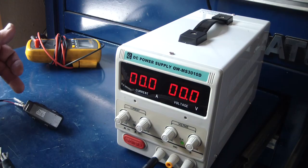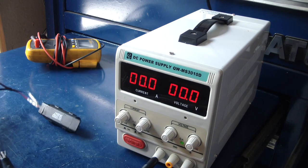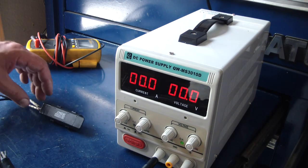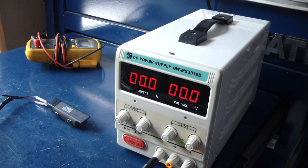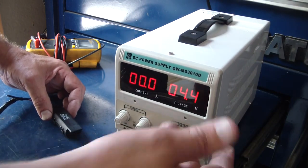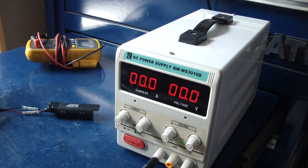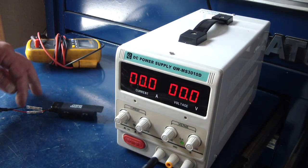So what I'm going to do is tape this up real tight, run the spiral wrap sheath up over this as far as I can, and then reinstall it. Hopefully now I've got a left vibrator that works and I stop getting that annoying 'Service Driver Assist' message. Cheap and easy fix — I'm pretty sure this is a common problem. I think the wires do break.